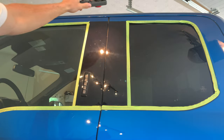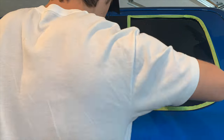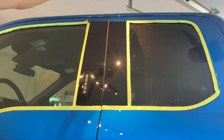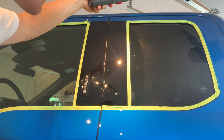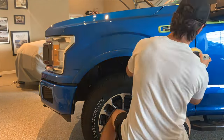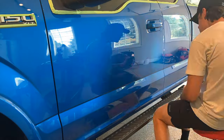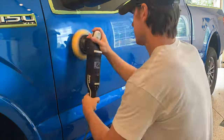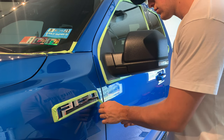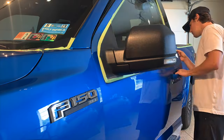The b-pillars are typically a very soft plastic which can be difficult to work with. I always start with the least aggressive method and decide if I want to get more cut after that. They can be super finicky, and if the vehicle is well used and pretty scratched up they're not usually going to come out 100% perfect. This is a classic example of the detailer's dilemma — as detailers we want everything to be perfect, but the reality is that every time we're polishing we're actually removing paint. So we have to decide: is it worth taking paint off with the potential to burn through the clear coat just to remove a scratch, or is it in the vehicle's best interest to leave the scratch and maintain the integrity of the clear coat to allow for more polishing later in the vehicle's life.